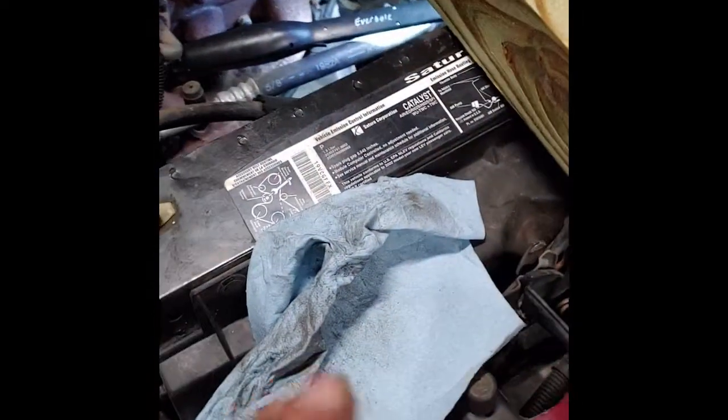But yeah, so there's the transmission removal on this thing. Had to take a pry bar. Had to pull the axle out because it was stuck in there. The axle nut on this one is a 30mm axle nut. Then there are 3 bolts on the axle mount that mounts to the back of the engine. They're 15mm. There's 3 of them: 2 on the bottom and then a long one on the top. Short ones go on the bottom, long one goes on the top because it's got a big wide spacer on it. So yeah, this is the removal of this thing.